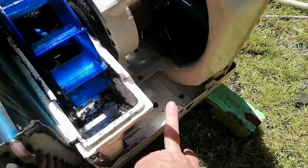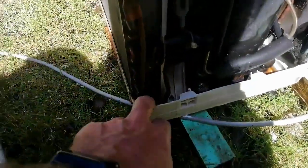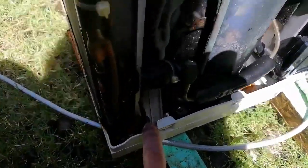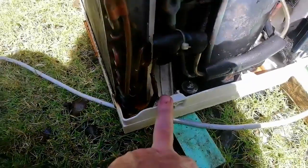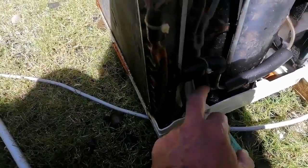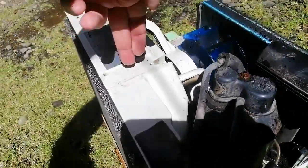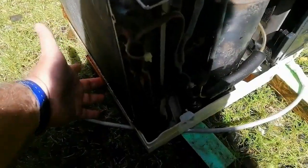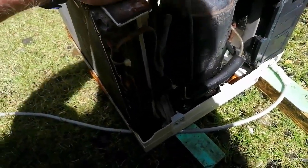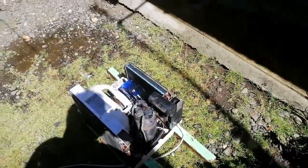This area is not supposed to have water in it at all, but we drilled drain holes because it's always about an inch and a half deep of snot over here by the evaporator. I also added one small hole here - this area does normally fill up with water and always gets stopped up because way up underneath the motor somewhere at the bottom is one drain hole, and it doesn't sit right. The hole was never cut exactly right and as soon as it clogs up there's no help for it.